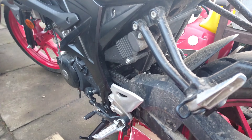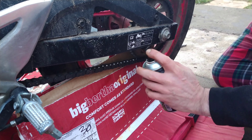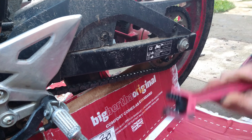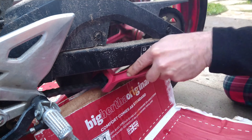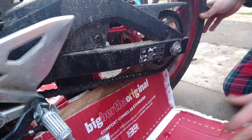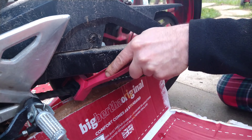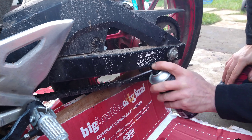There's time to get rust on the chain already. I've got the chain cleaner - I'm going to spray that - and I've got cardboard to collect it in. I've got this brush and I'm going to give it a clean. It will come up looking shiny new eventually. Keep spraying it on - after a few times it comes up looking really shiny. It's just the time of year, it's hard to keep the bike clean. I use this bike all the time to commute to work instead of taking my car.